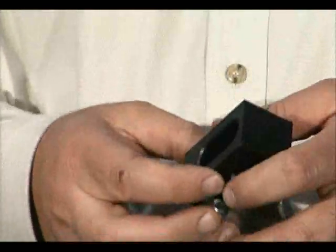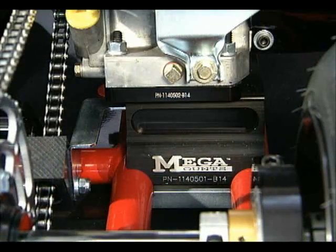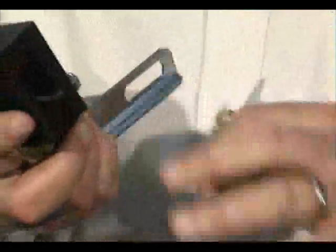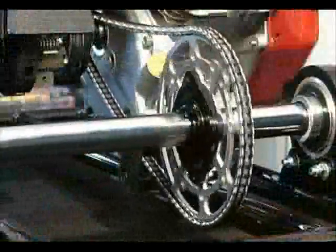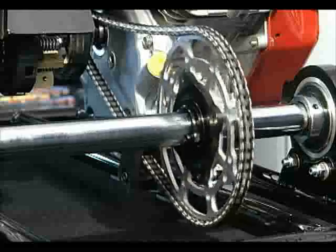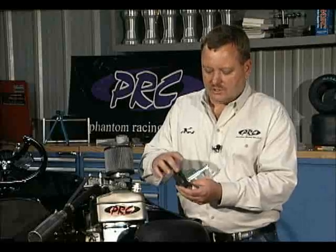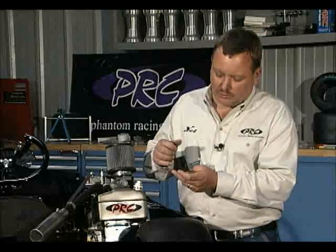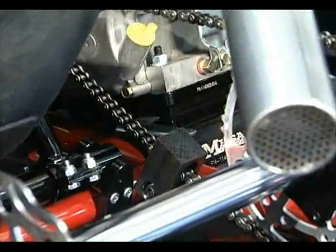The different holes just accommodate the different angle of the motor mount. With a flathead, you have to run those on approximately a 15 degree mount, which allows the back of the tank to clear the tire — that raises the back of the motor, so we have to drop the block down. With an animal that has the same crank location, we run it flatter to get the bowl of the carburetor level, so we have to move the hole up to get the block up. You're just trying to keep the chain running through approximately the center of the block. It's slotted so you can change different gear sizes without moving the block every time, but you really don't want your chain running in the very top or very bottom.